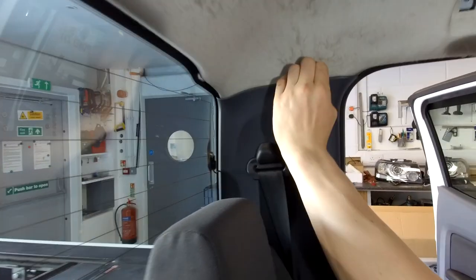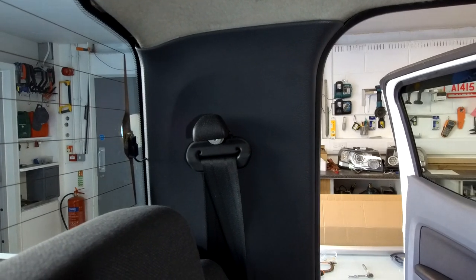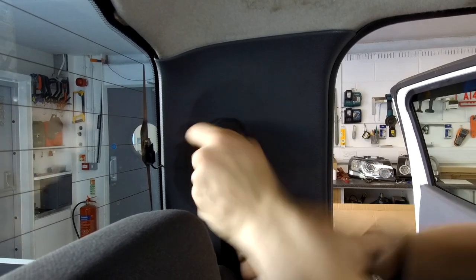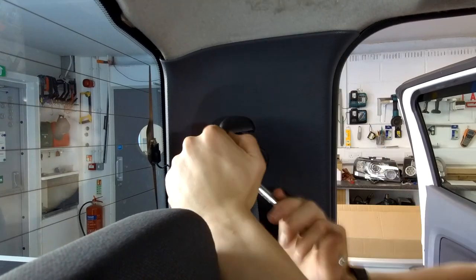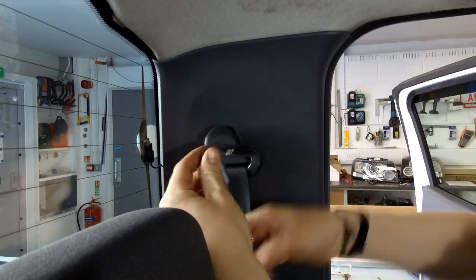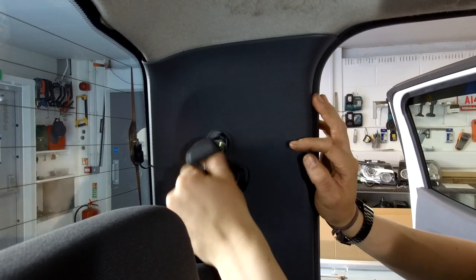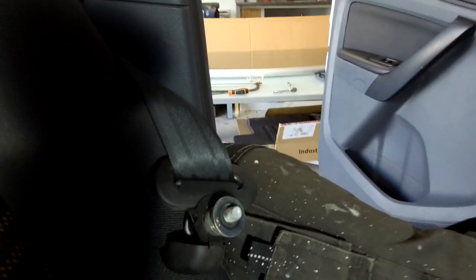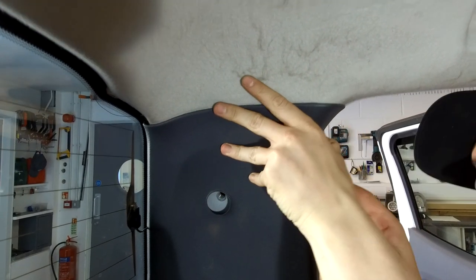The seat belt is holding the top of this trim. Slide a screwdriver underneath that cover and release it via a T50 Torx — that's a rare one, a T50. Sometimes these are loctited so they can be tight, but these aren't too bad. There's a lot less to do in the back than at the front. All the spacers and stuff should be held captive with that little fibery washer thing, so you can just drop that down.